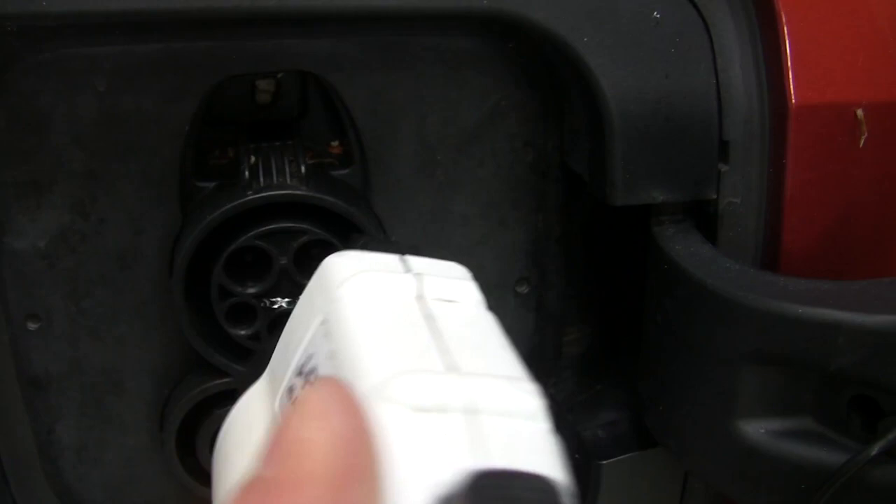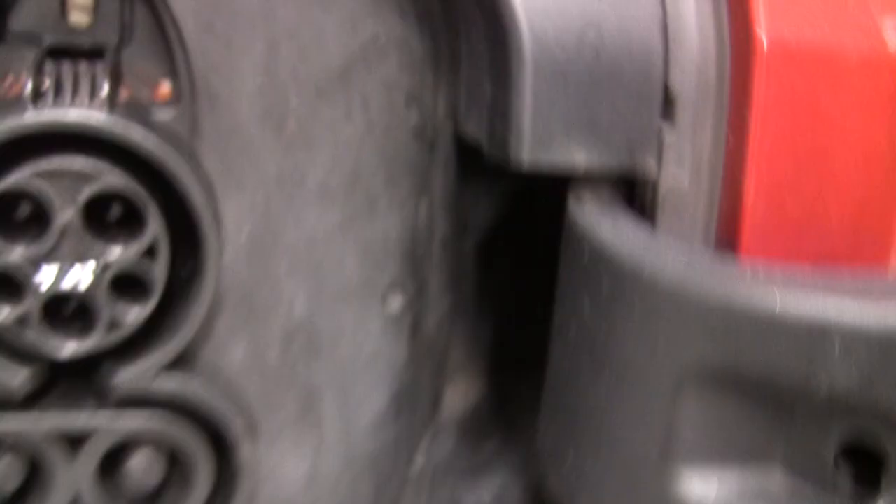Look at the plug here — you'll see there's a lock that holds the plug in and prevents it from coming out unless you push this button. For added safety, there's an extra pin — you see it in white, it's kind of mangled — that comes out in theory when you plug in and it's actively charging. If it were to come out, it would prevent the release from coming up, therefore preventing you from pulling the plug out. And by the fact that it hasn't come out, you can probably guess that that's the problem.